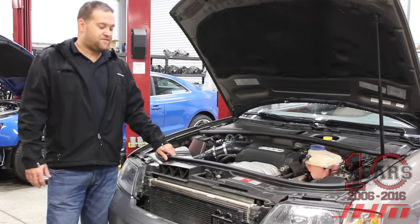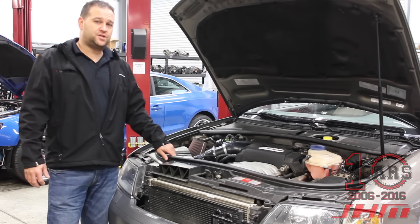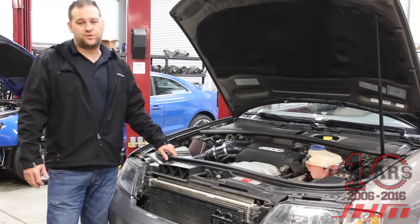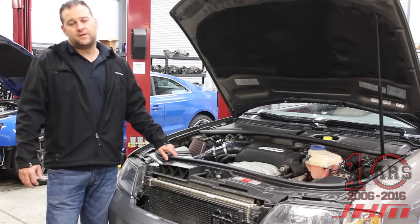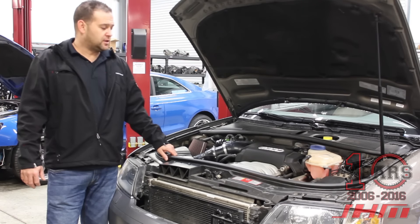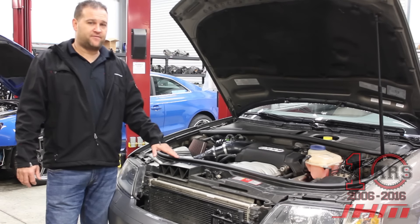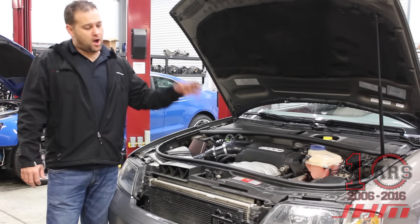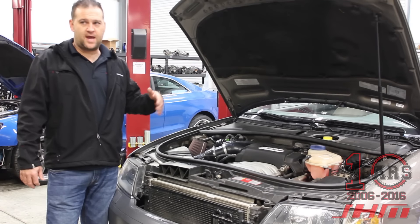We developed software for the engine on both cars when they arrived in basically stock exhaust, stock configuration. The other car — the one you don't see here — we fitted with headers from the B6/B7 S4, which bolt right onto the engine. The only modification needed was adapting the downpipe to fit the cat-back, which is going to be standard with these cars. The best cat-back available is the Magnaflow 2.7T system, due to the low production of this specific car.